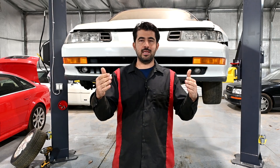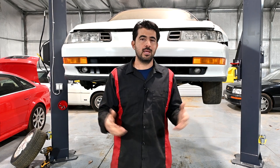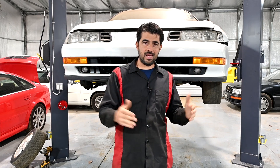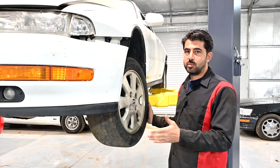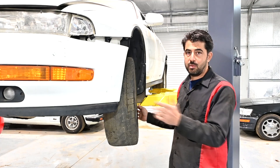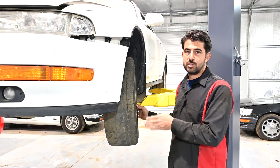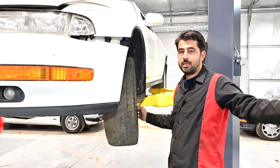On the other hand, having your wheels toed in slightly makes going around corners a bit more difficult — it requires more steering effort and delays your steering response, because the centering effect keeps the car going straight. Having wheels toed out slightly will make going into turns easier. For example, making a left turn with some toe out, the inner wheel — which has a shorter radius — is already pointed into the corner and will pull the rest of the car into that corner.